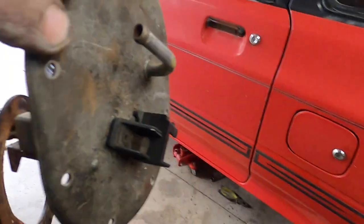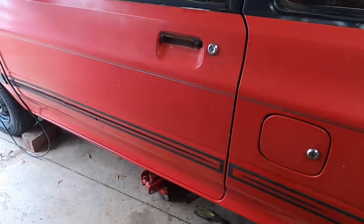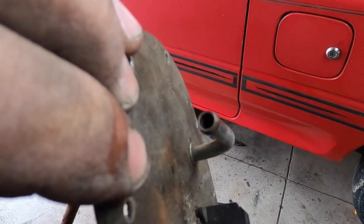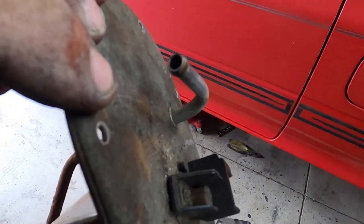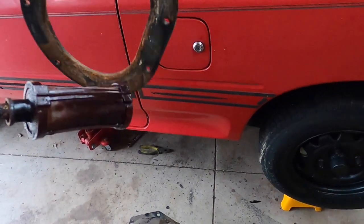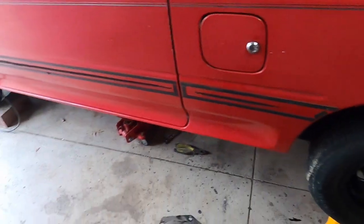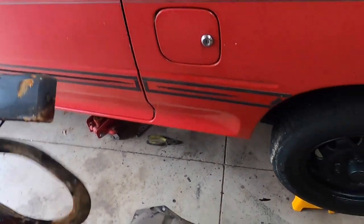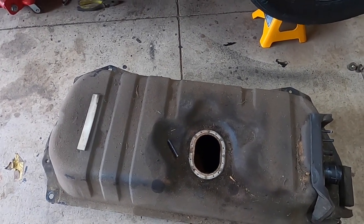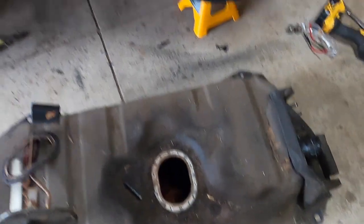Make sure it's getting fuel. I just blew down there — of course the flow would come the other way, but I tried blowing that out. Check this out — I'll put the strainer by the camera. Listen to this: I was blowing as hard as I can and really getting nowhere. It's so tasty. Yeah, this is at least going to need to be cleaned out, and it's probably a big reason the car was taken off the road in the first place.